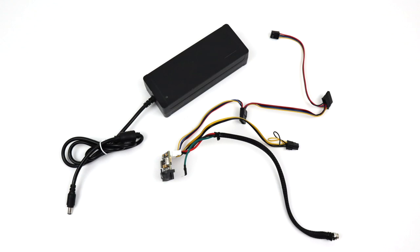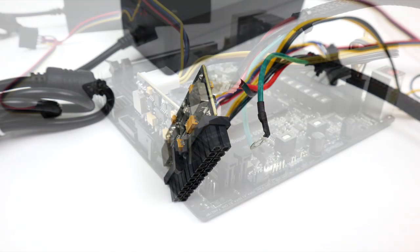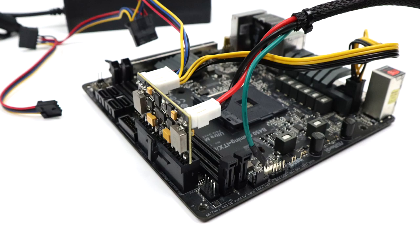Since we're working with such a small case you're going to need a power supply that fits inside. I opted for a 150W Pico power supply along with a 12V 12A power brick. This will put out 140W and it's plenty for the 3200G. If you're not familiar with these Pico power supplies — this is it plugged into the motherboard right now. We have power to the CPU, power to our main pins, and it also has connectors to power our SATA drives.